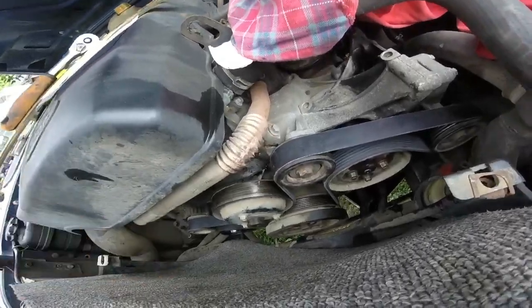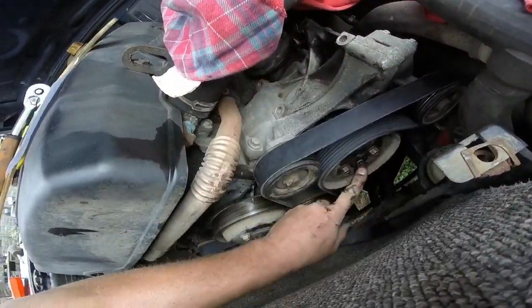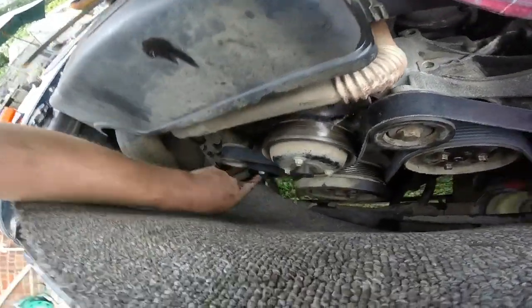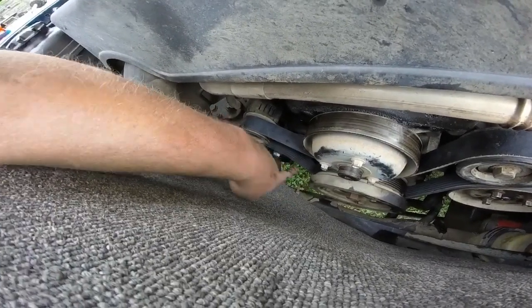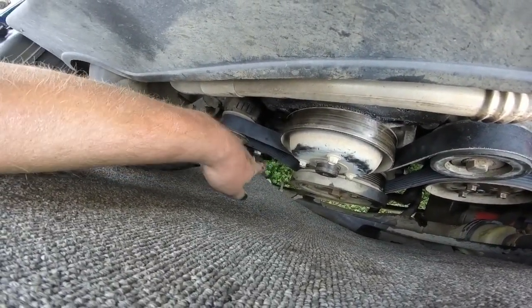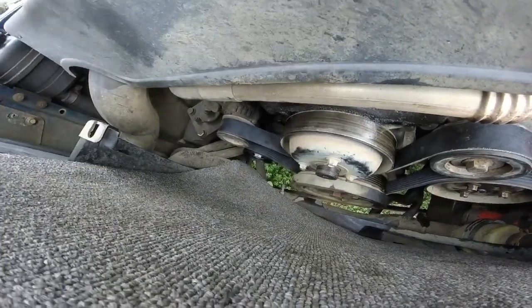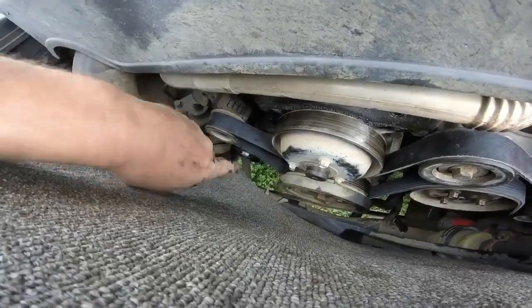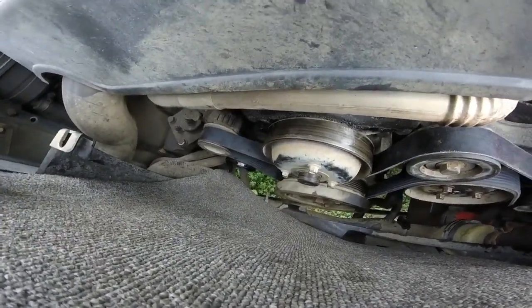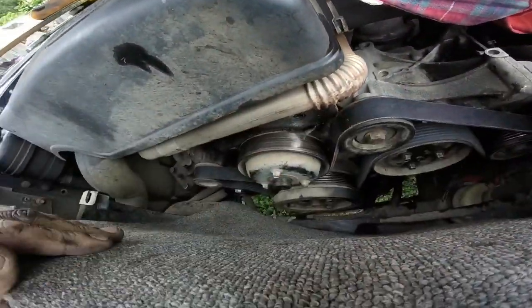I'll just double check every bolt what I've done. And them ones behind there were alright, them ones I'm sure are tight, and I'll just double check the tensioner one. And that bolt there, I was going, that must be a left hand thread, the opposite to the standard, because it would normally be undoing when I turn the tensioner over, so I think I read that they're a left hand thread. I've proved that to be the case. So yeah, pleased with that. It's all pretty good.